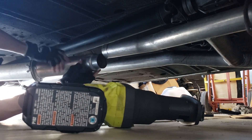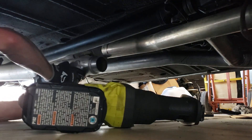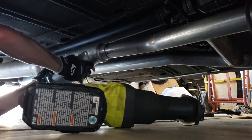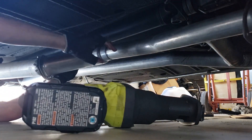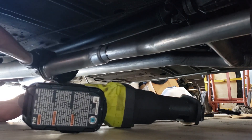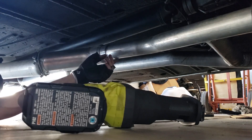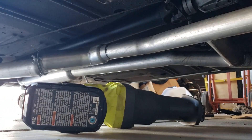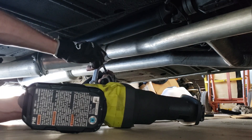It slides right over there and right into place. That's where our outside marks come in handy because we know how far to slide it into place. Now we know we have an inch and a quarter of metal between the two ends. Like I said, we're going to be using exhaust clamps for this method — eventually it will be welded in place.